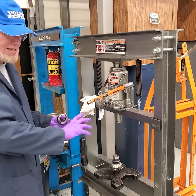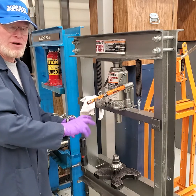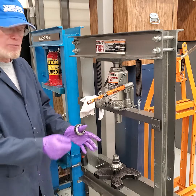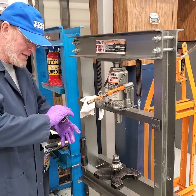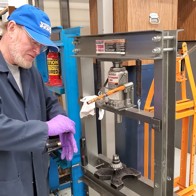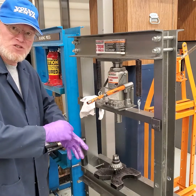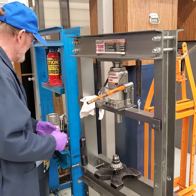If you put this back together and you feel any type of tension or roughness, you have to take it all apart, clean all the bearings out, hold the bearing, blow it out with compressed air, put some gear lube on it, then push down lightly and spin it in your hand. Make sure you don't feel any crunchiness or dirt in there. It has to be a hundred percent clean to do this.